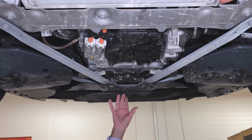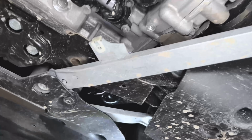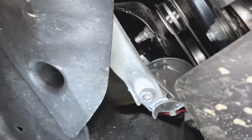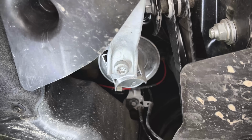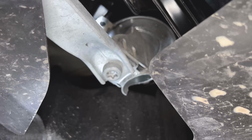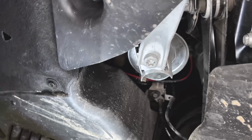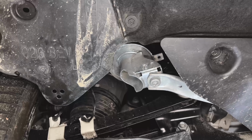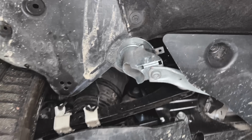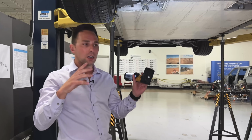And so what's happening with these X braces, like I said, although we've seen them in other instances, is if you look at how they're connected to the cradle, there's essentially an extension can, or like this little vertical structure. So it's that silver, it looks like maybe zinc plated stamped steel weldment. And that's picking up those braces across the rear cradle so as to tie in the structure. So essentially what BMW's been able to do here on this rear cradle is get a double shear plane on the entire rear cradle. So it's going to help with matchboxing.